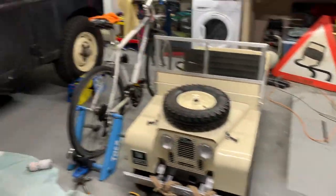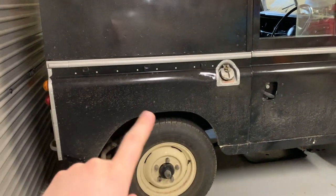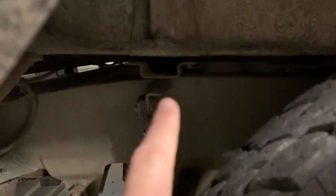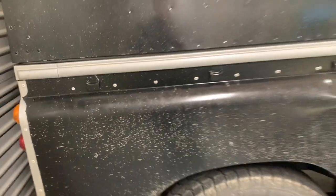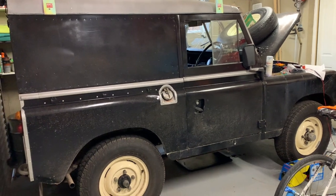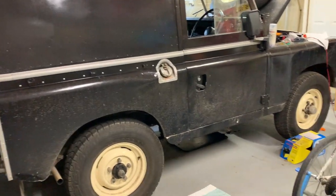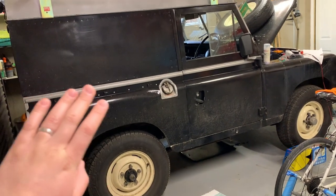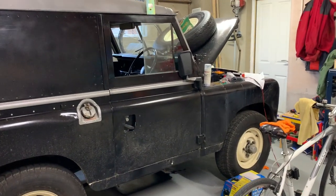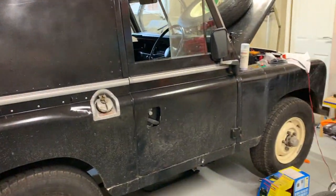The first panel I'm going to start with is the door, then probably the roof and side panels because they're easily removable. The rear tub needs quite a lot of work — it needs a brand new floor. These little struts have all popped off, and the floor is a bit nasty so it's time for a new one, a decent proper aluminium floor — not just a sheet of 2mm soft aluminium. A decent reproduction floor is about £200 delivered to Northern Ireland, so it's quite a financial undertaking. The plan is to paint it — a full exterior paint and interior of the tub — though I may have to do it in stages to keep it on the road, as it's a useful family truck.